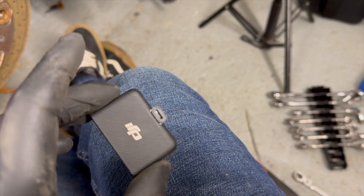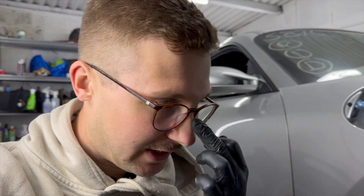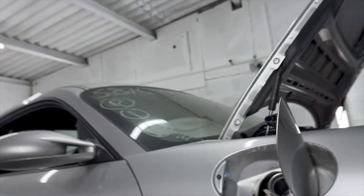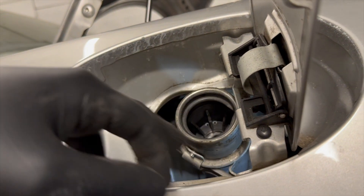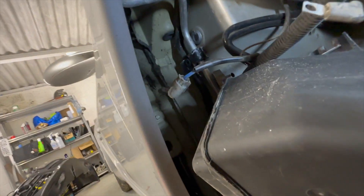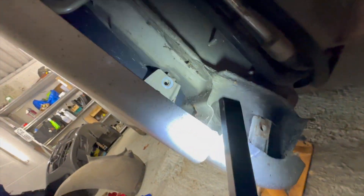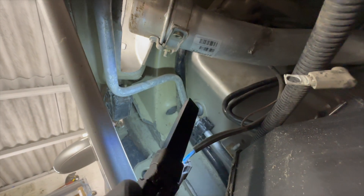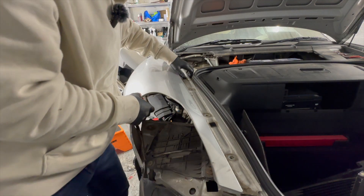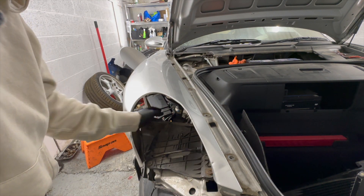Sad times — I've just dropped the phone with the microphone attachment and snapped the port piece off, so the camera mic will have to do for the rest of this video. The fuel cap top piece is out, the liner is out, and the washer bottle I've just left resting on top along with the overflow breather pipe. All that's left looks to be a 10mm there, a 10mm right at the top up in here — I already removed one below and one on the inside. I've disconnected the sensor for the flap, so the back edge of the wing is all done. I've just undone the 19s — the back one's completely corroded.